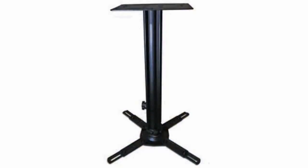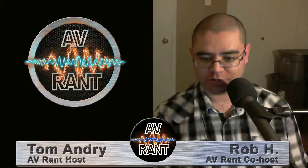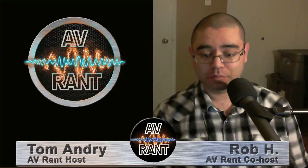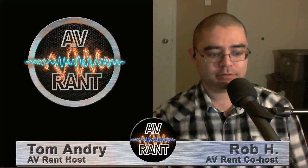Now, Silver Ticket does sell projector mounts. They have a $25 one that's extendable, but I'm a little wary of that because they described it as great for larger projectors like the Epsons. The Epsons are under 20 pounds. I was going to say, that's not very big. If they're calling that larger, then I'm a little bit wary to put a 35-pounder on there. So to me, I'd stick with the Peerless or the Chief. I'm sure the Sanus ones are fine too, but those are the two I know and trust completely. You do pay a premium, but I think it's worth it. $100 for a $7,000 projector, not too crazy.